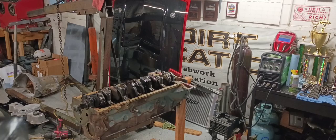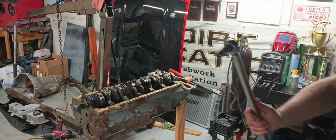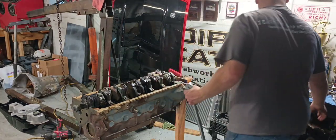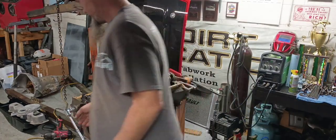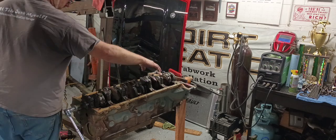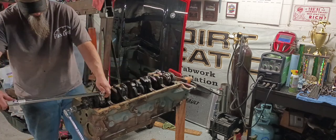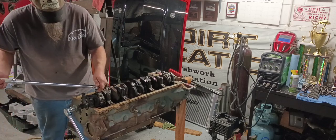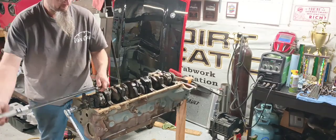And alright, guys, the rod bolts on these torque between 40 and 45 foot-pounds. I have my torque wrench set to 40. So where I'm going to attack this one, I've already got 4 rods up here, 1 and 2 and 5 and 6. So I'm going to start at 1. I'm just going to ease up on this number, working from side to side.